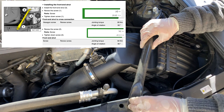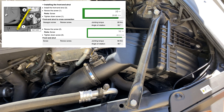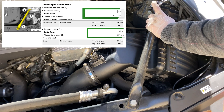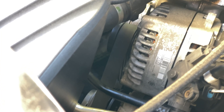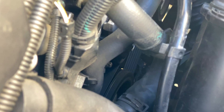With that firmly in place, we're ready to put the support bar back in. Tighten it down fully — there may be torque specs, and if there are I'll put them in the description below. Do a quick look over on everything, start up your engine, and listen for any weird sounds. Make sure the belt is riding in a centered location, not wobbling, and it should be good to go.